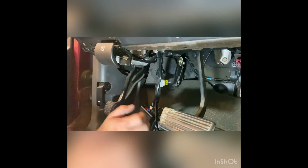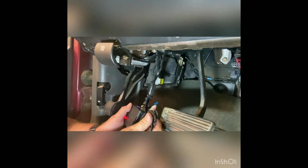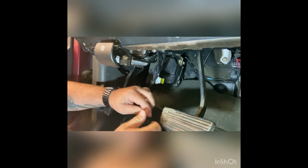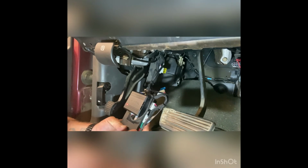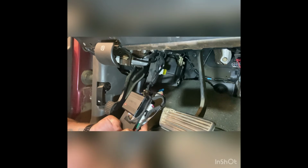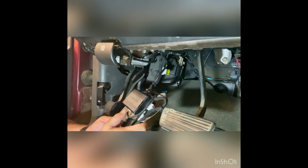So at the end of the day, this is our basic goal. Here's our control unit with our interface module. All of the harnesses and everything are very neatly tied together. Oops, I forgot a wire tie right here. Everything looks very uniform and tied together, very intentional. There's nothing on here that looks accidental, which makes everything look clean and neat and tidy. So basically now I can tuck this up underneath the dash, and I can use one of the mounting locations to secure it in location with one or two wire ties, and now this thing is fully secured.